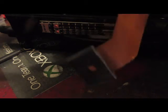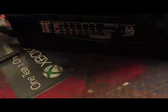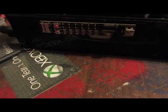I didn't mention, the reason we shaved the clip there is because there are some components on the motherboard that sit a little close to the NOR chip, so the only way to get it to sit flush and read every leg is to shave it down. Once we have it shaved down and placed on the board, you may need to use something to hold it in place.